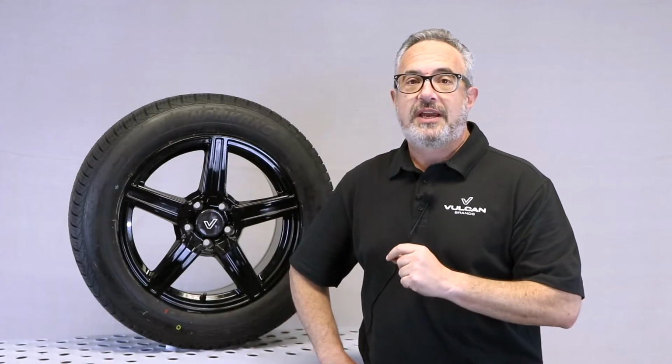Always read your safety tag for all the pertinent information. Remember to check the label on your device for the safe working load. Never tie down by less than 4 points on any vehicle. Inspect your vehicle every 50 miles. Consult your local DOT for specific regulations.